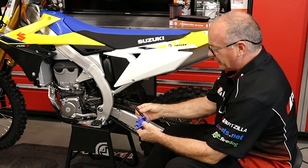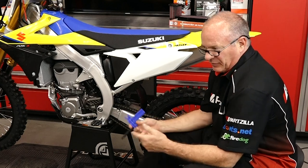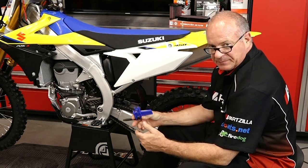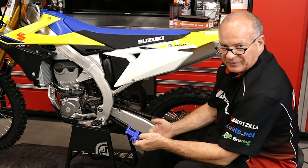There's no reason to reset the zero point on this particular make and model. Now on some of your street bikes, you'll have to compensate for that and set the new zero point. But once you have the zero point, you just bring the chain down and take that measurement.